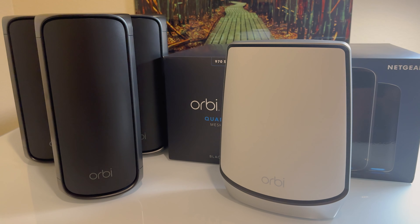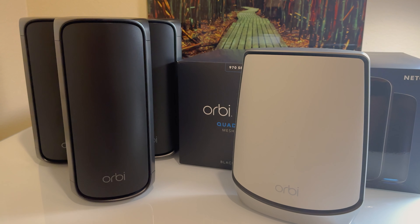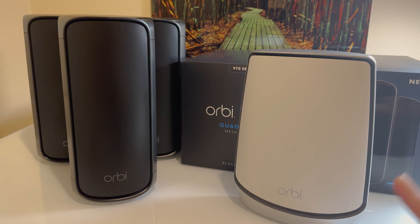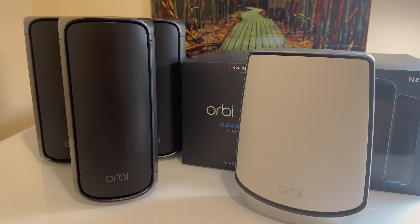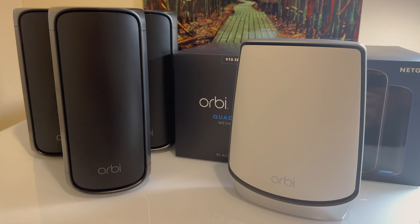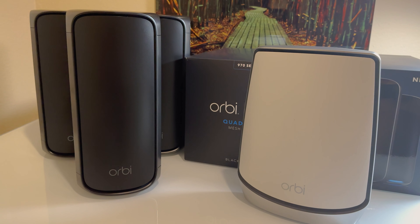The prior Orbi generations were on Wi-Fi 6 and Wi-Fi 6E wireless backhauls. The downside is that wireless signals in higher frequencies — the 5 GHz range — just didn't penetrate as well. It was 2.4 and 5 GHz, and we couldn't really cross the network's different frequency ranges very well. The backhaul was limited in speed, so even though we had gigabit internet, our throughput on the backhaul was usually at best 500 megabits, or about 50%.